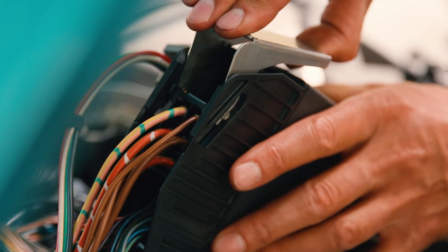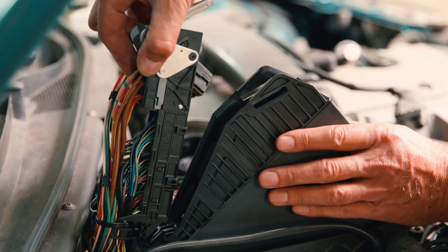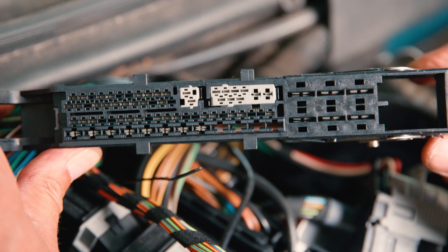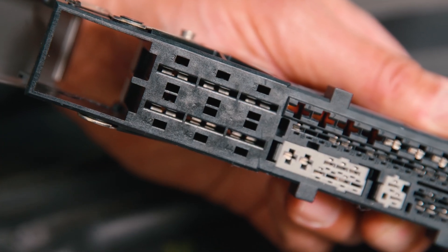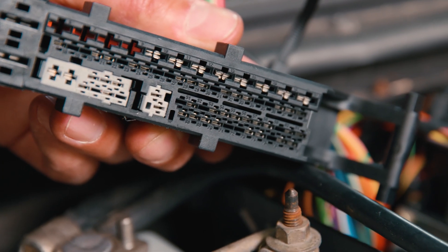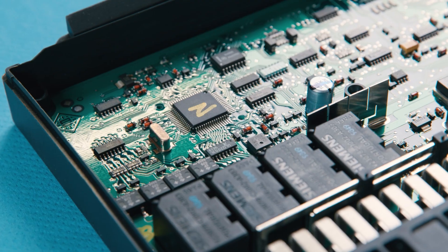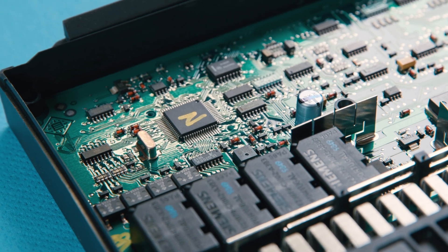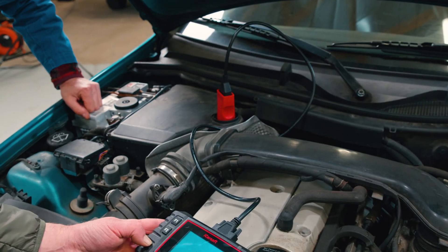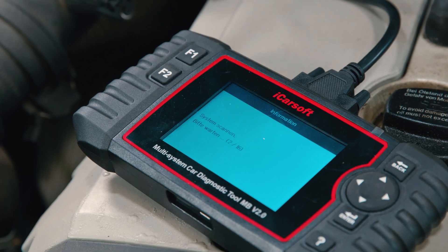This is the main power supply — with this you can also pull the remaining connectors. Here's the top view of the long vehicle-side connector. With glasses, the numbers corresponding to the contacts become visible. Our end position switch states arrive here as input potential and can be accessed or simulated. Just by the number of poles, it's evident that the comfort control unit integrates even more functions, such as turn signal and window lifter controls. Alongside other devices there's also signal exchange, for instance related to vehicle speed. Its memory is also queried during error diagnostics. We attempted unsuccessfully to diagnose through the 38-pin socket. Occasionally we hear about issues such as those traditionally caused by cracked solder joints, which are addressed in the repair industry.